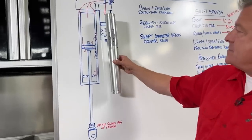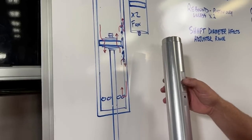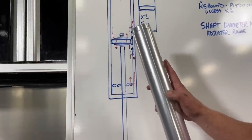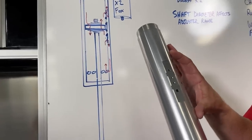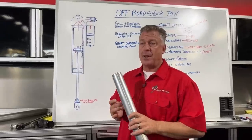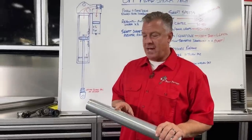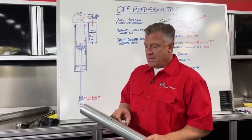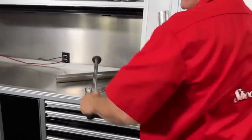Here's a bypass tube — a cutaway showing bypass ports on the side and the piston. These bypass ports normally have valving bolted to the side that gets pushed open to allow flow. The size and location of these ports control the plush ride quality you feel in the UTV or any off-road bypass-style shock. This valving isn't really a highly tunable item — ultimately what controls the most is port size and port location.